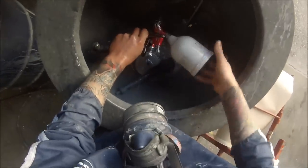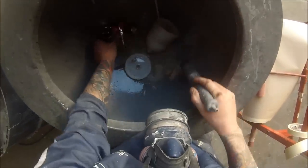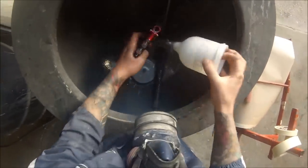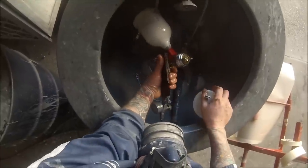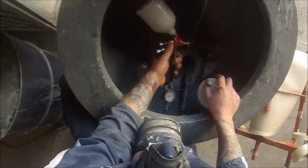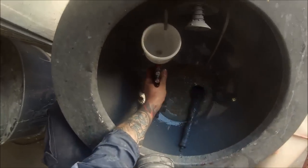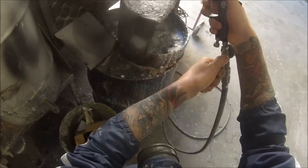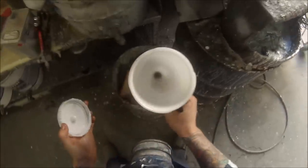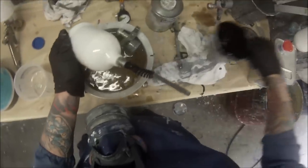Recycling your thinners — if you're at home, grab a couple of cans and save yourself a couple of dollars. I decided to pull the pot off this time mainly for the sake of the demonstration. Then I like to run some fresh thinners over it to clean off all that murky recycled thinners — give it a good rinse off. Then add just a touch of clean thinners to back pressure through the gun again. Apologies about a couple of the camera angles — having the GoPro on made it hard to know, but most of the video was worth using so rather than re-record I decided to use this footage.